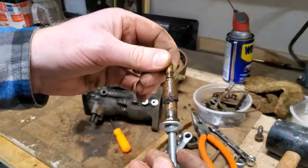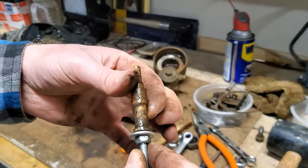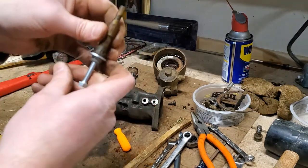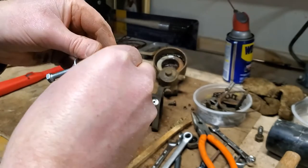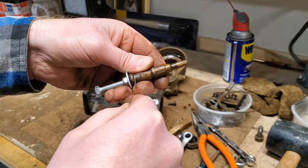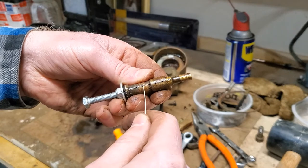So that right there — you can see all of that rust right there. You've got holes there, there, there, all up and down this, and all of these holes are just clogged full of this super fine rust, so you've really got to clean those out. I have a piece of big welder wire — I think it's 30 thousandths. That one, that one is still clean. That one's clogged. I think there's one up here too. Anyway, all up and down that you've got to get all those holes in this tube cleaned.